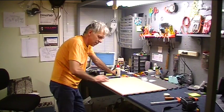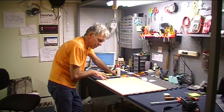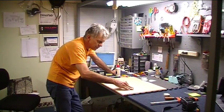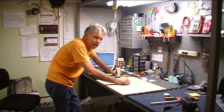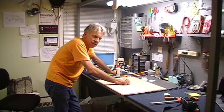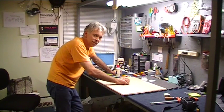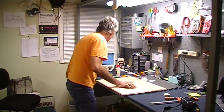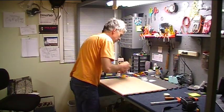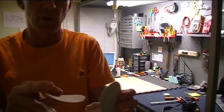So I took it and ran it through my circular saw by hand with a level just clamped onto the thing. And now I'm polishing the edge with a 3M headlight polishing kit that I got from work. I'm working now as a BMW, Mercedes, Porsche mechanic, and the newer Mercedes headlight covers have a tendency to get all yellowed out, so 3M makes a really cool product for that. The kit comes with these pads.